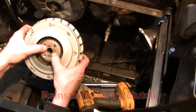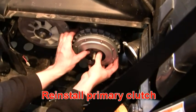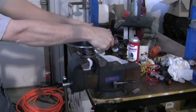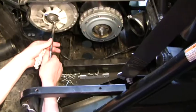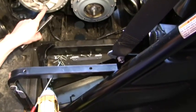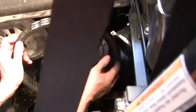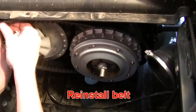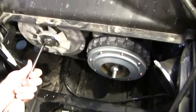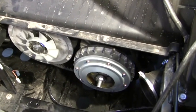Make sure the rollers are pushed all the way down so the cap won't slide back up. Use the screw that's included to back out your belt. Put your belt on your drive clutch first, then roll it around into your driven. Back out that bolt and reinstall your guards.